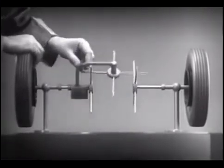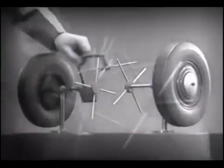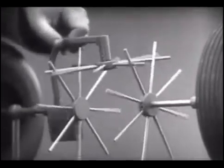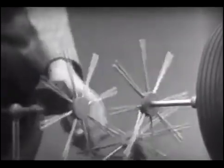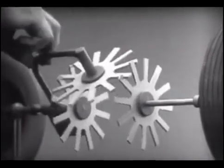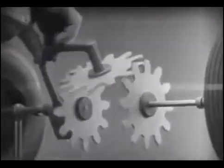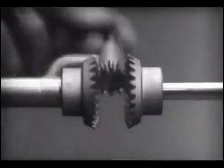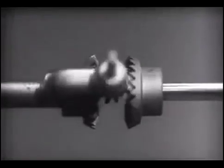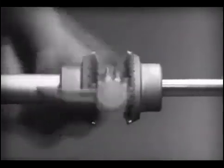To adapt the model for use in an automobile, we will have to make a few changes. In order to reduce the jerky action caused by wide spaces between the spokes, we will put in more spokes. Further filling in the spaces between the spokes gives steadier, more continuous action, and changing the shape gives firm, constant contact. Now we can make the gears thicker and stronger and we have differential gears. The edges are cut so that they will fit together more smoothly and silently, and another gear is added to share the work of driving the axles. The principle is the same.